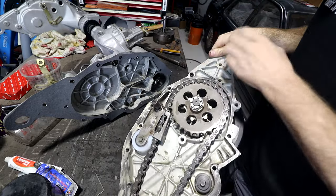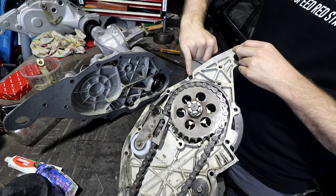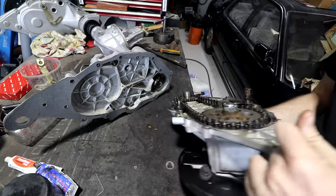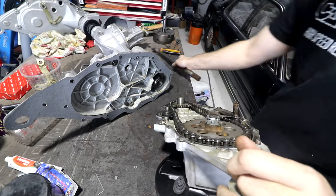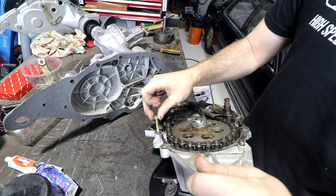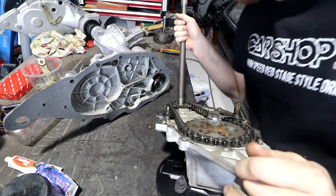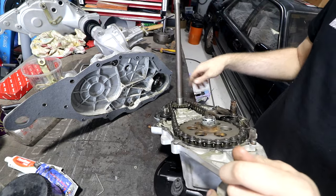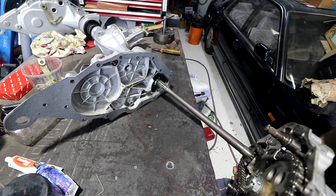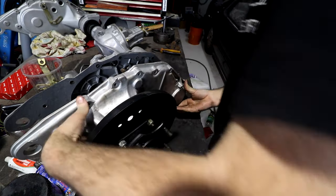I do have one dowel pin here, one dowel pin on the other end, so I'm gonna make sure those aren't missing. You notice when you pull stuff like this apart, there's always a couple of these little dowels that stick out, tubes. They're a much tighter fit in the holes than the bolts are, so what they do is do the precision alignment for everything, and the bolts just hold it together, because the bolts, when they're in the holes, they're not actually a tight fit. That's why you'll see gearboxes and stuff always have the dowels. So you always need at least two dowels to align something, because obviously, as you can imagine, if there's only one, it can still pivot. So that's always something to watch out for. Make sure your dowels don't end up falling out or get stuck somewhere. Make sure my aluminium washer is still where it's supposed to be.